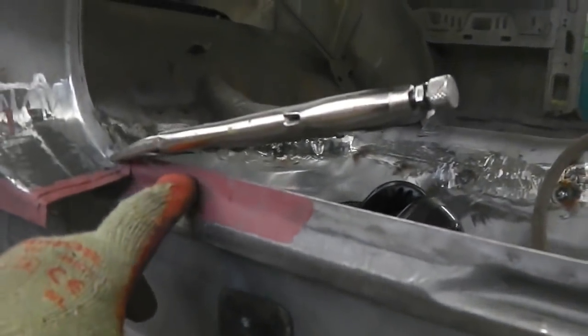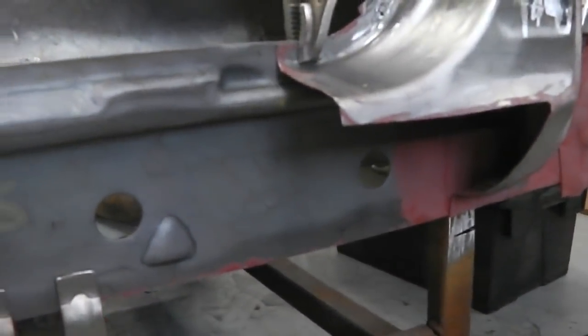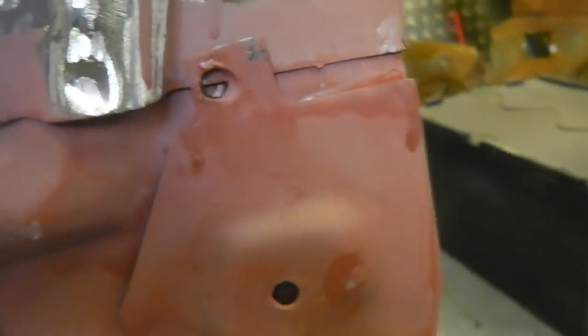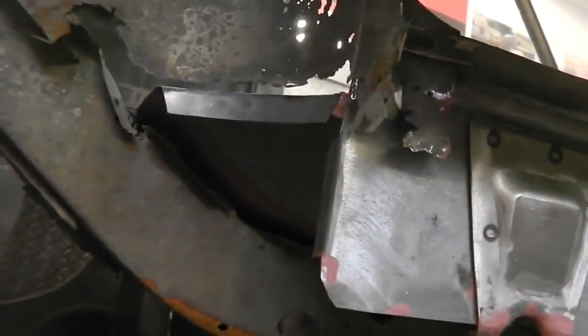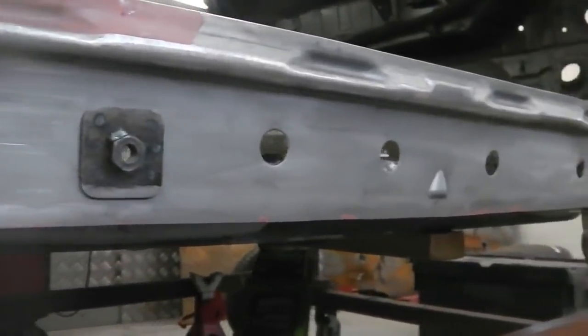What we'll do, we'll double check from there to the top again and make sure that's what we measured before we took the old sill off. We'll correct at the front, lining up with the conduit tube impression there. Across we go to the back, the jacking point lines up with the jacking point there, so we're okay. We're at the end on here, which we should be for the wheel tub fixing point. So really that's it, that's an inner sill going on.